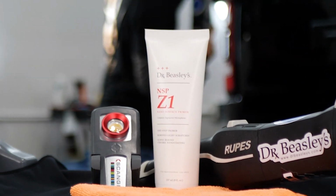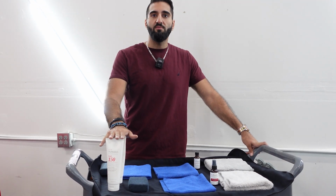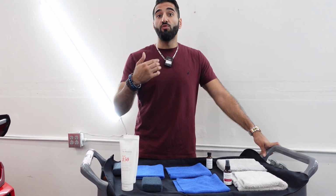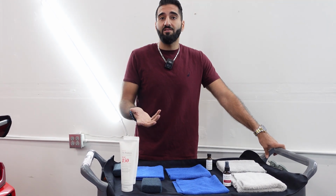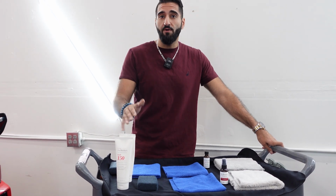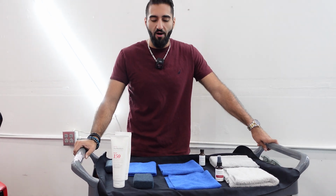After your priming stage, you pretty much even out what you've removed in clear coat. So we really don't have too much of a difference when it comes to paint thickness after you restore the paint. Now, on your traditional compounds and polishes, you just remove clear. You're not reinstalling anything onto the surface. That's what's so cool and unique about these. They don't contain any waxes, oils, or solvents, so they're safe to all your painted surfaces, and also speed up the process a little bit for us when it comes to restoration service as well.